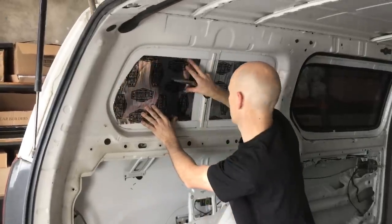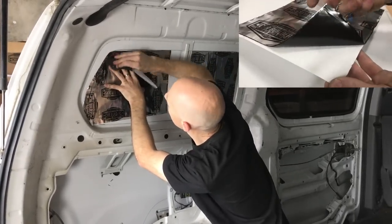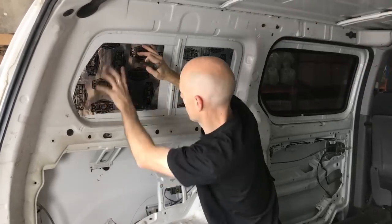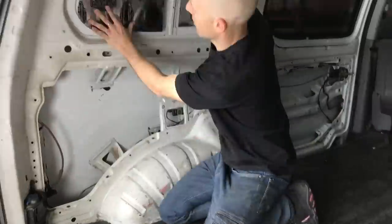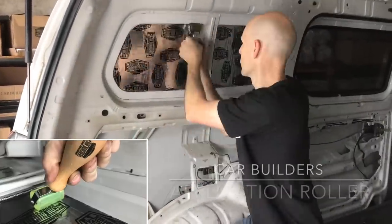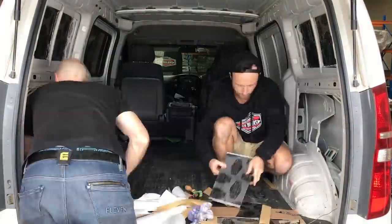What the material consists of is a rubber lower layer, which is self-adhesive. It doesn't actually have an adhesive glue on it. The actual base material itself is sticky. This means for, I guess, vertical applications and inverted application, the product will stick and you're not at risk of an adhesive layer breaking down over time and the product failing. This is why a lot of the automotive manufacturers will use this and they will put it throughout the car, and it does get used on roof skins.